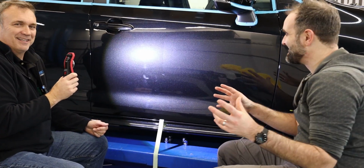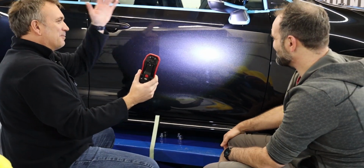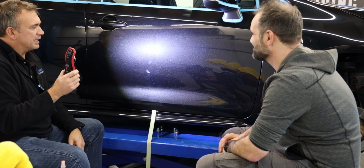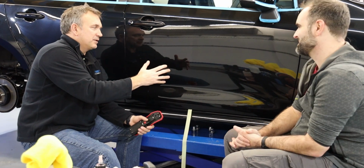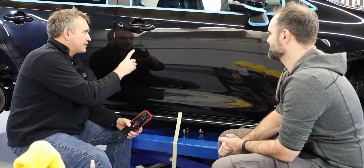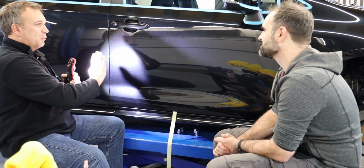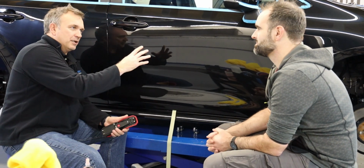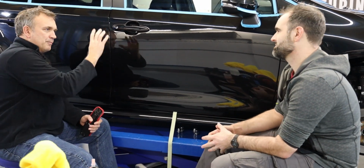So at the moment, the whole passenger side looks like this. Yes. The roof, the bonnet, the bumper, the back bumper. Yeah. So this side of the car still has to be done. So we've got this dullness, this matness. But what it's done very quickly has removed the light defects here now, so we can hopefully explain to the audience. I can see, and you did it on the bonnet last night, those very faint wash marring marks would go over with a one-step foam pad. Yes. But we know there's localized deeper marks, you did one earlier up there on the wing.